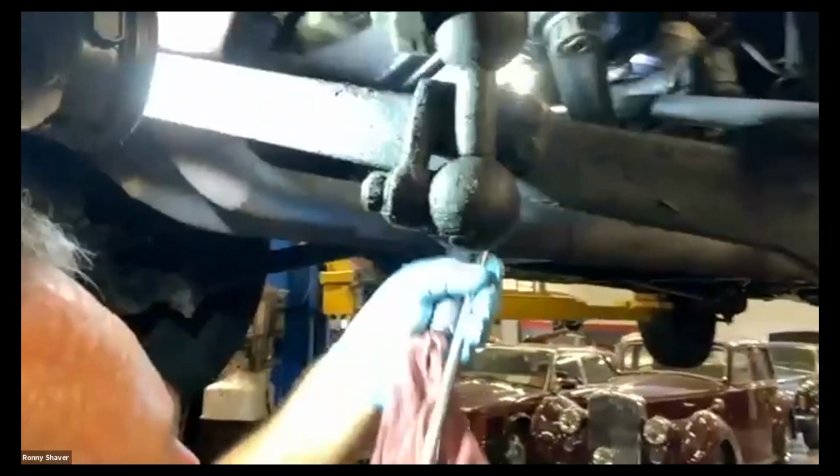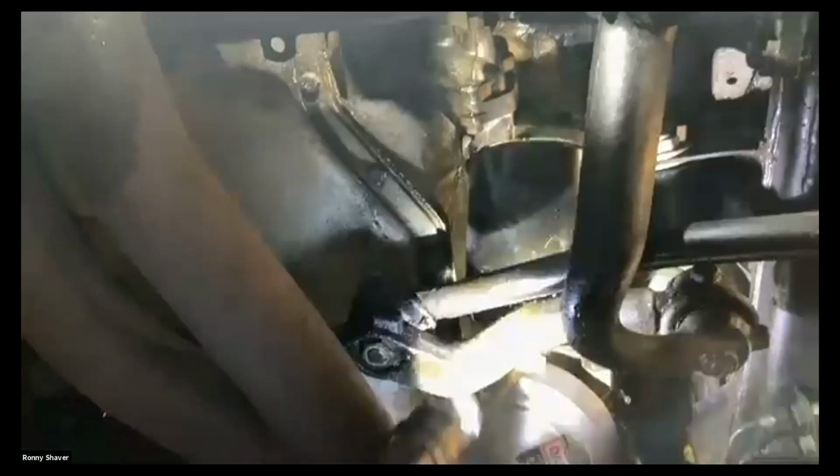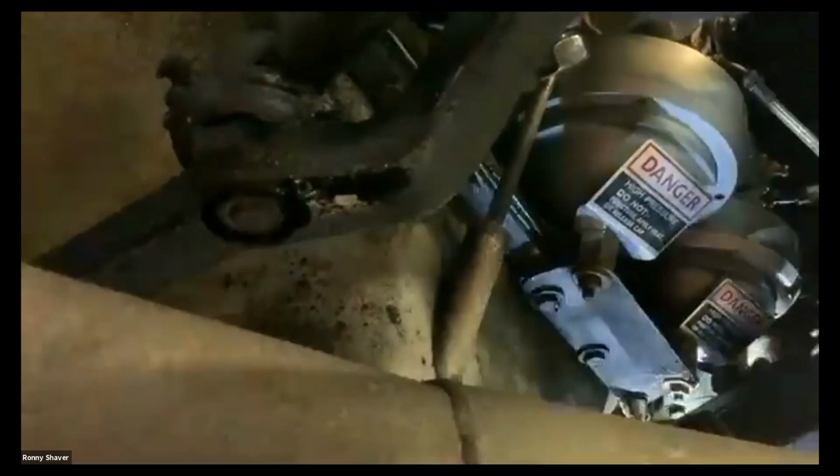There we go. So as you can see, there's an oil pan bolt. These are 7/16. They're actually quarter 28. Sorry, we're going to go down and tighten them all so I can see them. These are all good and secure. That one's going to be hard. These like to loosen up. A lot of oil leaks I've fixed on these cars is just a matter of tightening it up, and it reduces it to just, what do they call that, seepage.